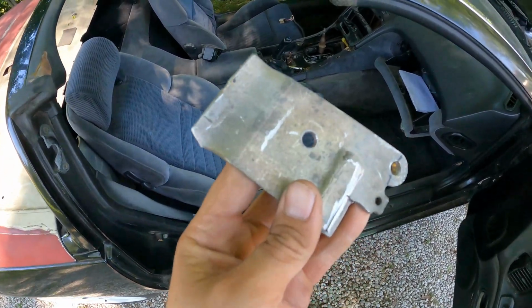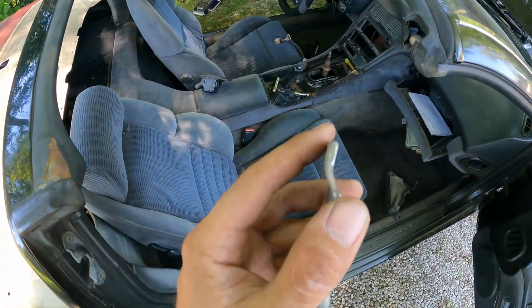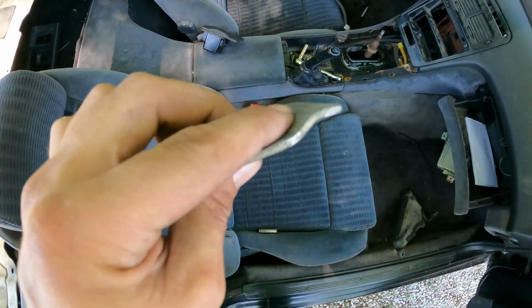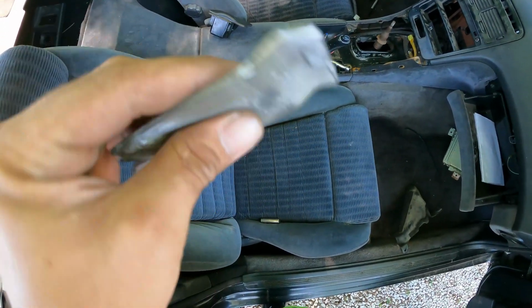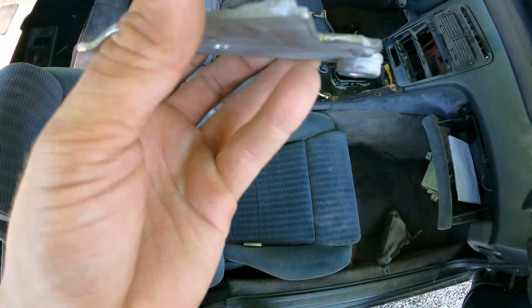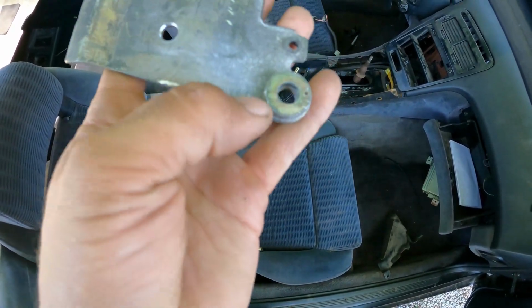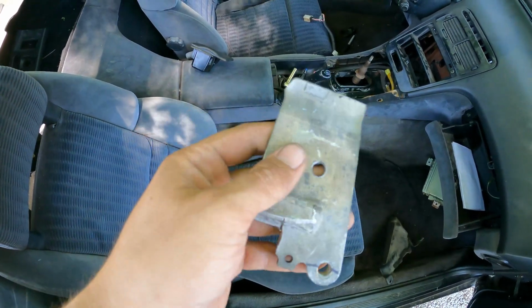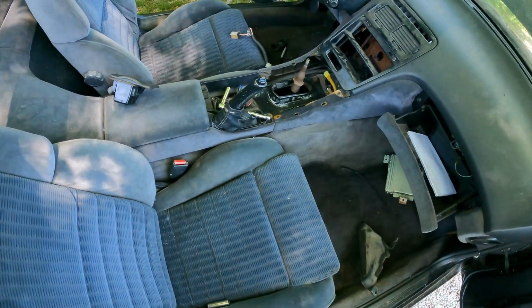It's gonna be oriented this way, and instead of us keeping the step on here to hold it on this bracket before we weld it, we trim this off because this actually jumps down and it should hug right there. I was gonna leave the lip on this side, but I decided to leave this instead since it does stick down a little bit and will give us a little bit of structure before we can weld the thing.